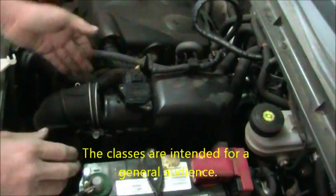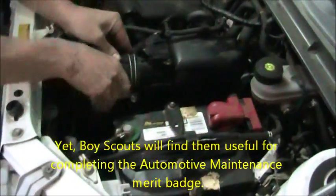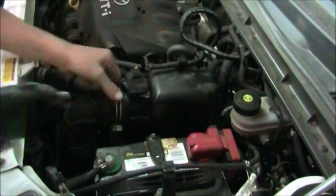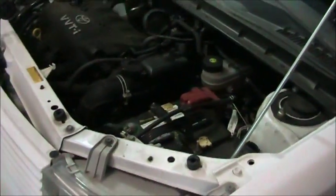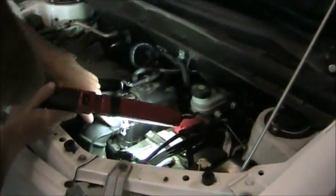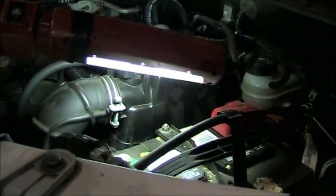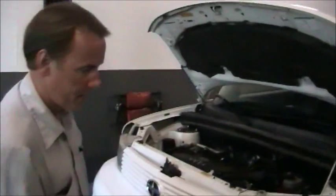Now I'm going to press the front down. I'm going to push this clip up, push this clip up. I'm going to reinstall the air inlet hose. I'm going to tighten that bolt. It doesn't need to be very tight. That's tight enough. A good indication is if you look at the threads on the bolt, you can see that I've tightened it right to the same location it was before we started here. But hand tight with a screwdriver is plenty sufficient there.